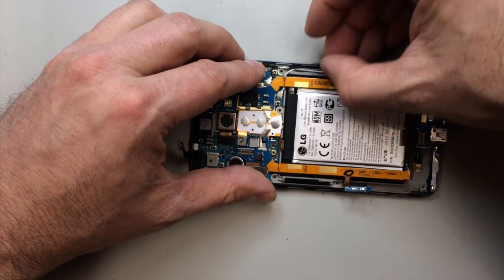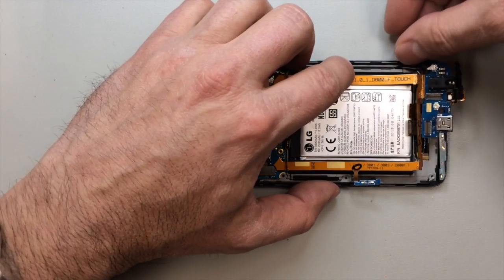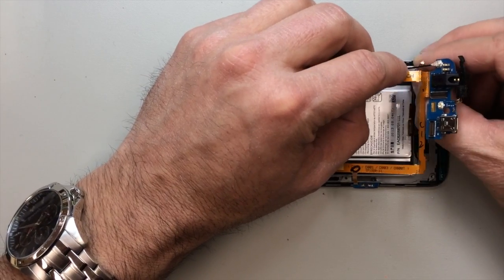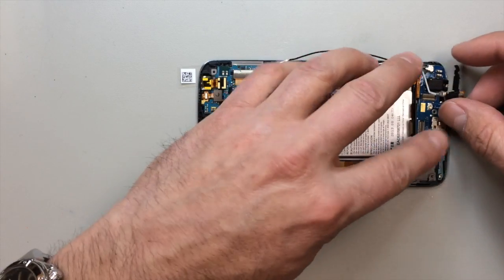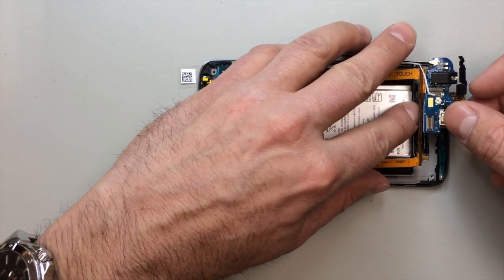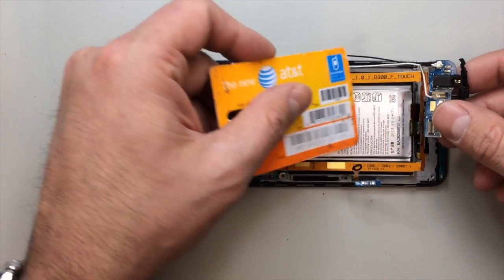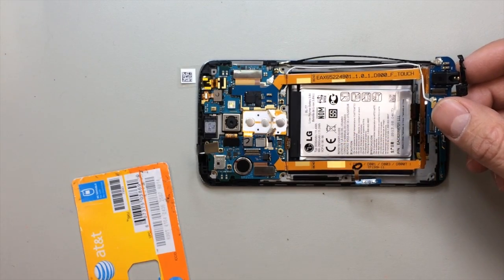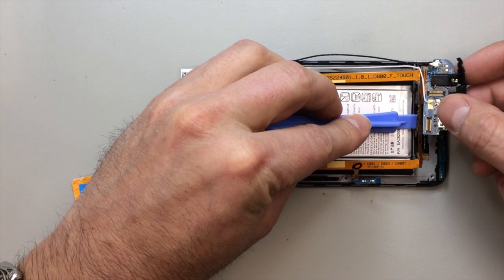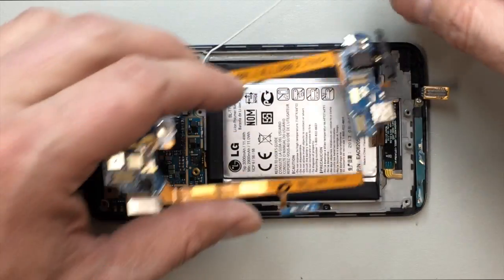The antenna wire came disconnected at some point during the repair — make sure these go right down the channels designed for them on the side of the phone. There's actually one channel they share in the area I'm working on. If you don't have your antenna wire down in those channels you will pinch them when you put the back panel on the phone, either causing reception issues or putting pressure on them. These are pretty fragile and unique to this phone, so if you break those antenna wires you'll have to find a replacement. Down at the bottom routing everything can be a bit frustrating — you've got all sorts of different cables going in different directions and this weird plastic piece attached to the microphone area. I'm not sure what they were thinking with this design.